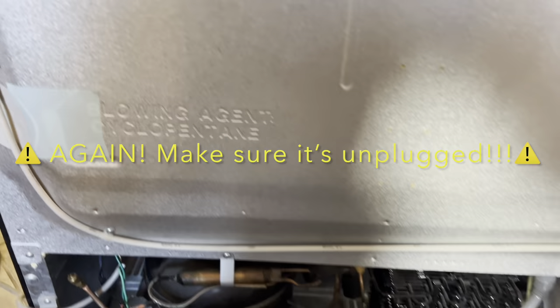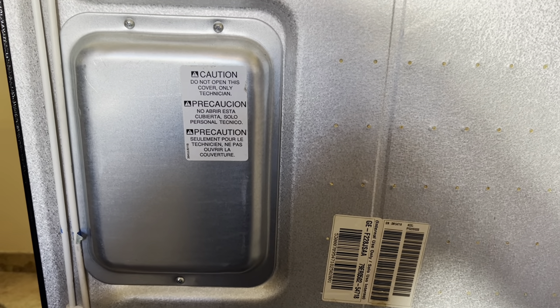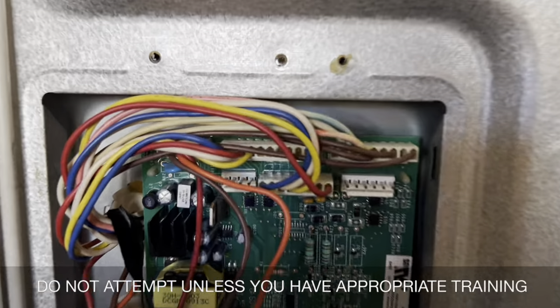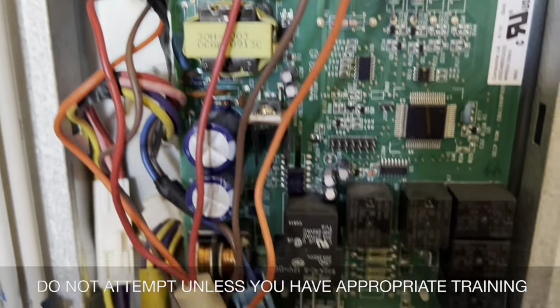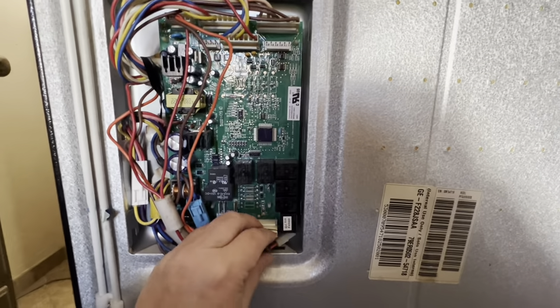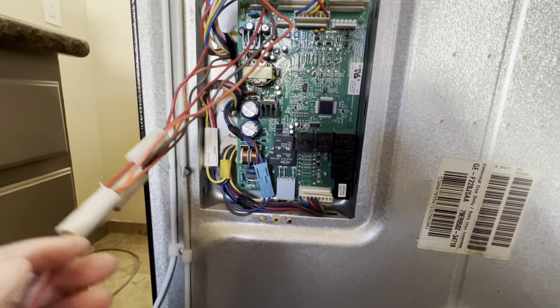So this is where we started working, and the panel control board or whatever it's called should be behind this panel. I'm just going to take out those three screws. Here's what it looks like behind the panel. Take a picture so you know where everything connects into. If you have the same refrigerator as me, you'll be interested to see this was just tucked in here — it's not really connected to anything, so that would have confused me later.